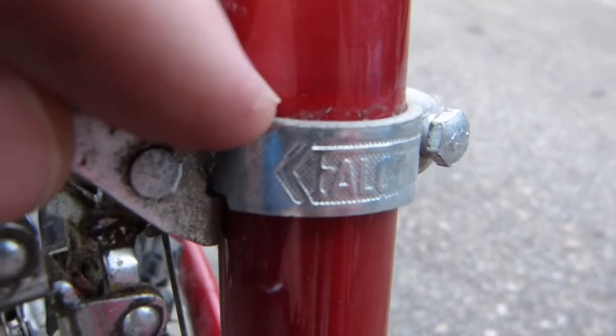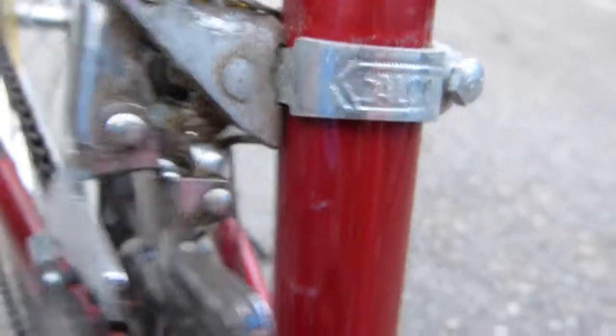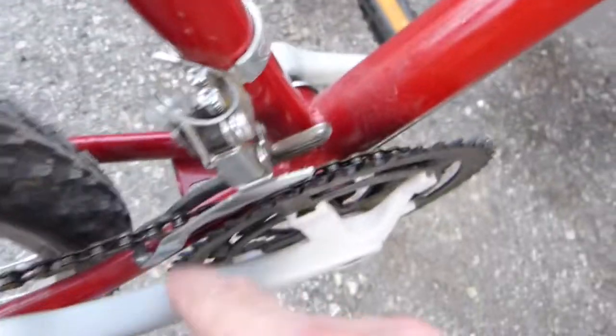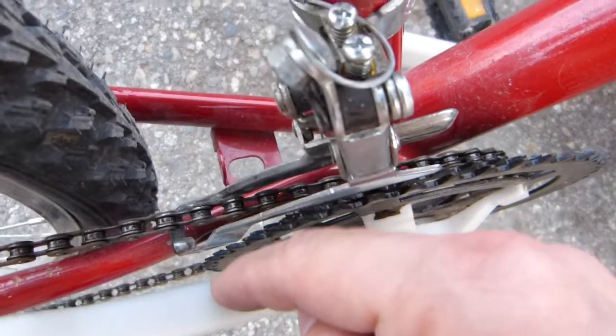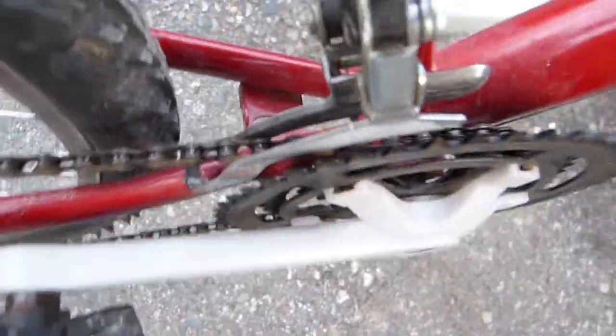The shifter at the front was also adjusted a little bit. It was lowered by about, I don't know if you can see this dirt line on the frame, about 1/8 of an inch, like 3 millimeters. It was also rotated, so it's actually parallel with the chain rings below, yet allowing, on the biggest chain ring, a clearance between the crank arm and this bulging part. So it was just shifted a little bit and adjusted.